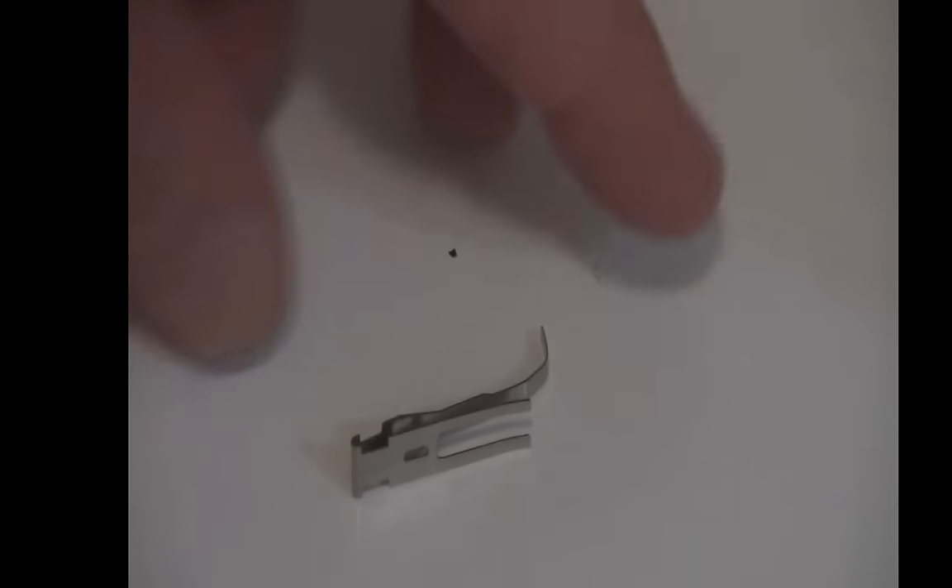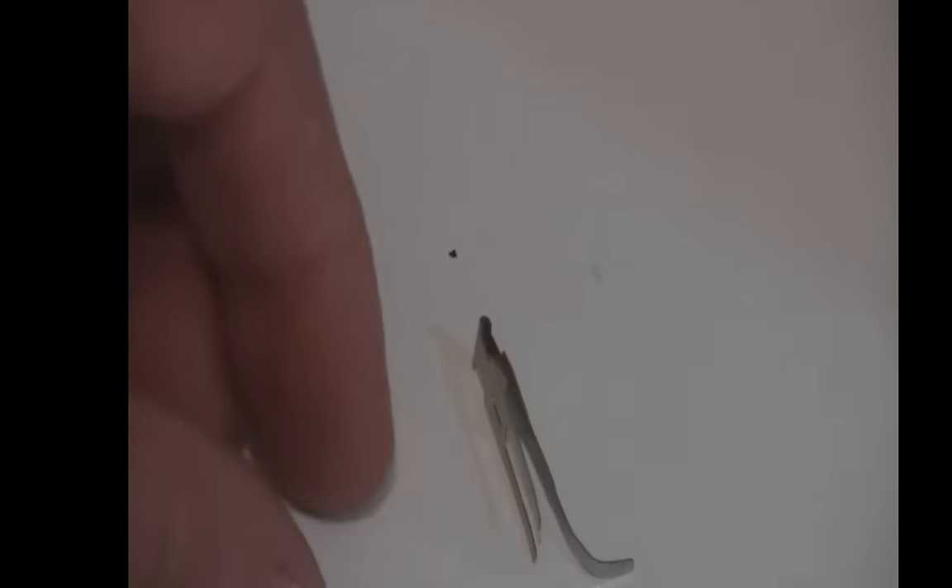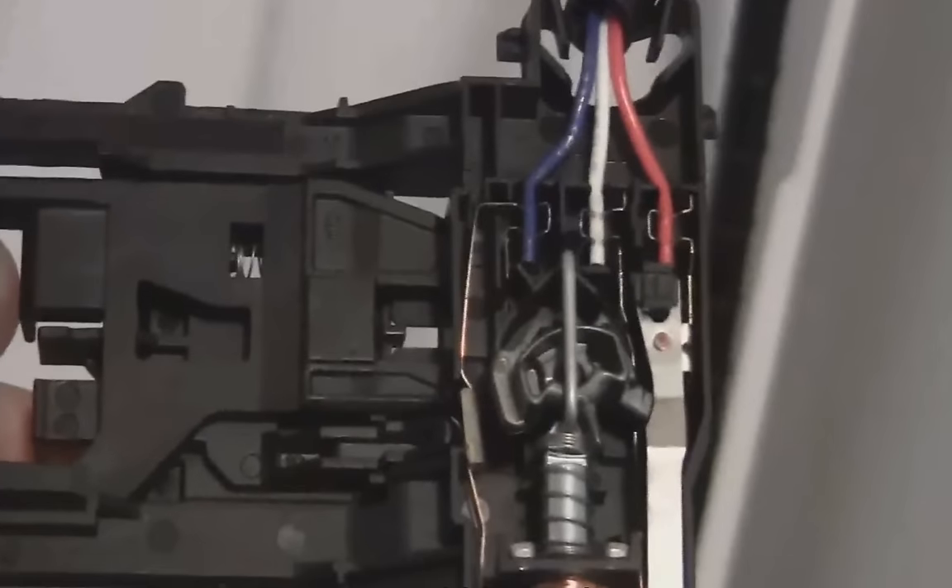Here's a better shot of that metal part so you can see how big it is. This clip actually fits right here — it lines up right there. When this sliding mechanism slides forward, it pushes the clip underneath all this stuff, and this plastic piece gets pushed down and the clip gets hooked behind it. The rest of the video will show how this plastic piece gets pushed down and how it all slides forward and fits together. As long as you can get this plastic piece in — which only fits in one way — and these only fit in one way, put the case back on, clip it back onto the top of the washer, put the latch in so it's always latched, and your washer will work again. I guarantee it.